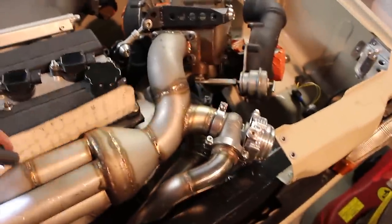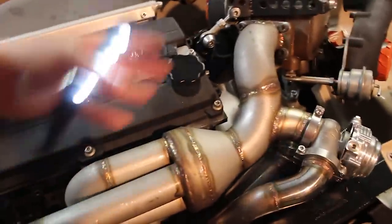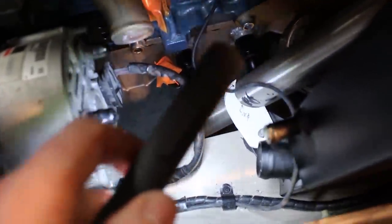I'm mocking up a cardboard template for a little folded heat shield to save the rocker cover and gasket — probably doesn't need it, but I figured I might as well whilst I'm cutting some other bits of stainless. I've also got a bracket down here that bolts onto the cotton reel for the radiator, and I'm going to TIG weld it onto the screamer pipe downpipe. I've also got a little brace in here that goes from the downpipe to one of the bolts that holds the gearbox on. I'm also doing a crazy folded piece out of mirror stainless steel as a heat shield, because the wire here is the CPS sensor and it's really close to the downpipe. I'll also probably put a silicone fibreglass sleeve over that as well, just to keep the heat away from it.